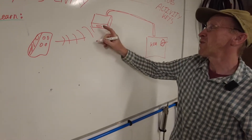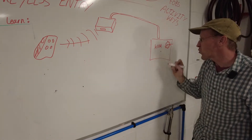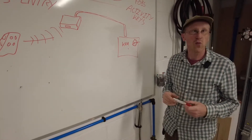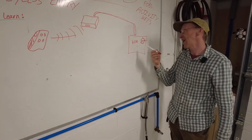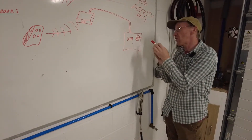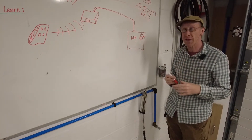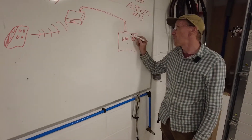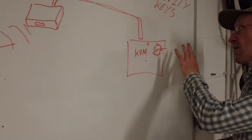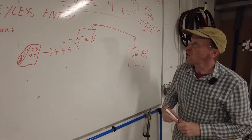Where problems occur: the radio receiver module seems pretty reliable, but the KVM module does seem to have some sensitivity. We've heard stories of people plugging diagnostics equipment in and the KVM blowing. The good news is the KVM modules tend not to completely fry themselves — they seem to have some component, maybe a fuse, resistor, or capacitor, that blows, making the module non-functional.